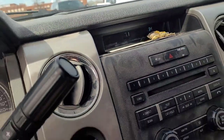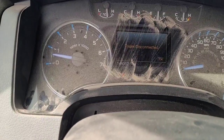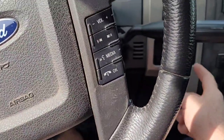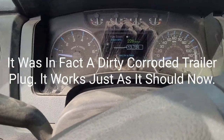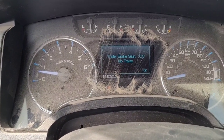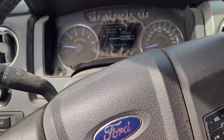It charged me a half hour — $56.90. Slide this over — it says 'trailer disconnected.' We think it's a bad connection, because if you go rolling and you slide this, the trailer does stop. So we're thinking it's a bad connection — it's saying 'trailer disconnected.' We can change the gain here — it's coming up, you can go all the way up to 10, go back down. So it is working but there's something going on back at the connector. But that's all there is to putting the factory trailer brake controller in your 2010 through 2014 F-150.